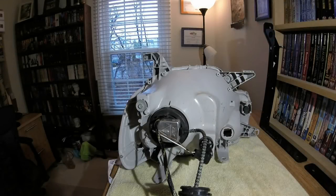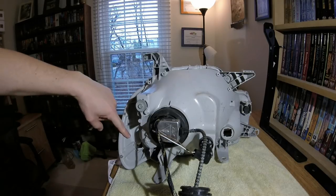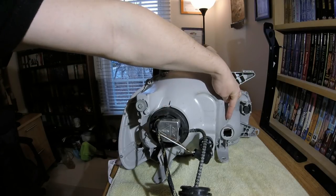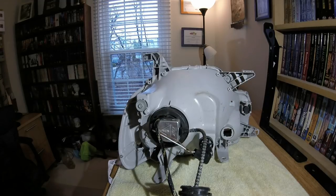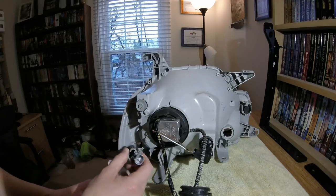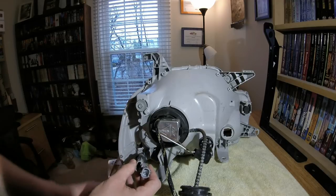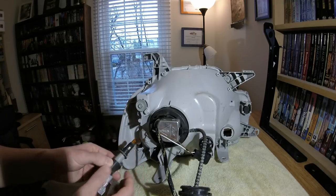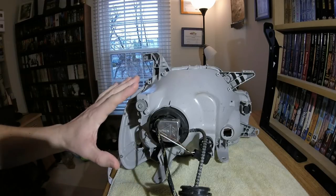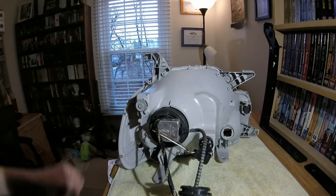For the final part that is often overlooked: if you have regular halogens, you will have three large holes in the back of your headlight housing — one for the side marker, one for the main headlight high and low beams, and one for the turn signal and daytime running light. When putting your bulbs back in, make sure they're seated properly. If there's any play at all, redo it and make sure it's in there tightly, because water can still get in if the rubber gasket isn't firmly seated. Don't do all this hard work and then get lazy installing the bulbs.